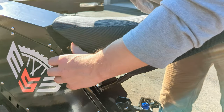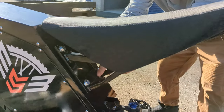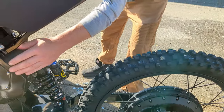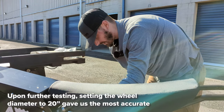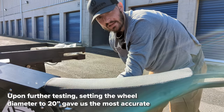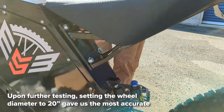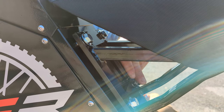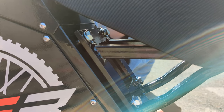Make sure you watch your wheel size on these because the tires are super tall. To get the most accurate speed reading, with these tires I had to change my wheel size to about 29.5 inches — that gave me an accurate speed reading. It kept saying I was going way slower than I really was. You take care of that on the display: double-click the power button for settings and you'll see wheel size there.